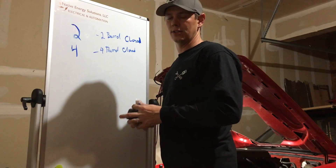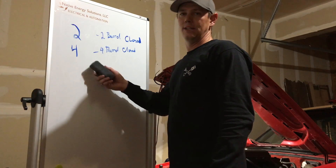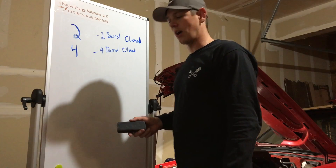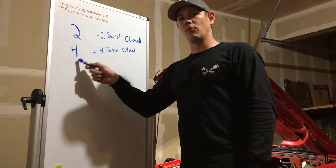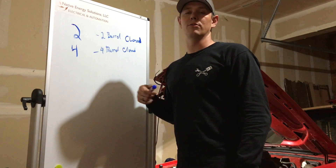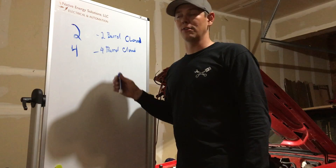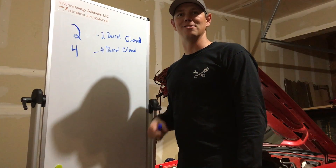There are other ways to tell on the cylinder heads — factory stamps, markings, numbers, all that good stuff — but this is the best way I've found and it's fairly consistent. All the heads will be marked with something indicating two barrel, four barrel, open chamber, or closed chamber. To summarize: four barrel closed chamber heads are better for higher RPM applications, and two barrel closed chamber heads are better for lower RPM. If you have any comments, questions, or additional information, please share below. Thanks guys, have a good one.